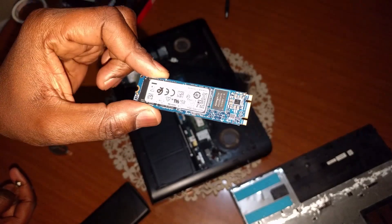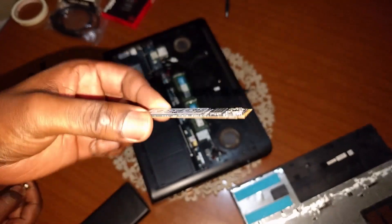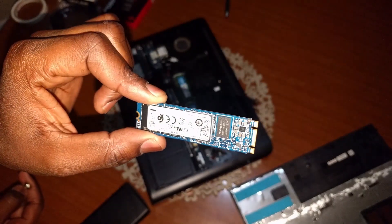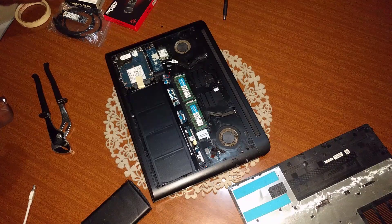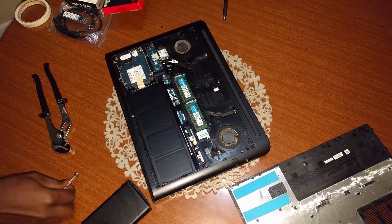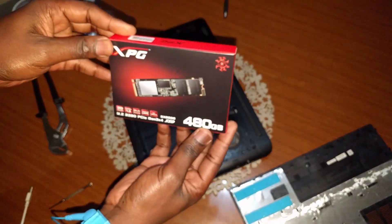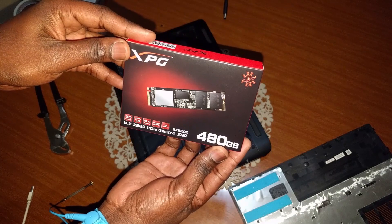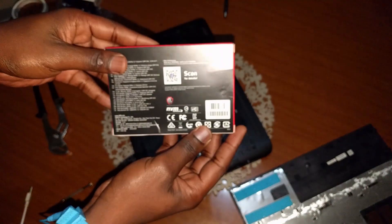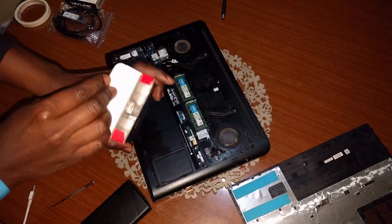The next step will be to open the lid up once again. Remove the old M.2 SSD boot drive and replace it with the new NVMe drive. The ADATA NVMe drive comes in a minimalistic box containing only the drive and the heatsink, which is to be stuck directly onto the NAND flash modules and the disk controller. To stick it onto the drive, peel away the tape cover and align it over the screw hole and the flash modules.